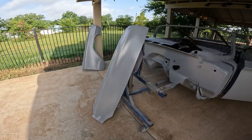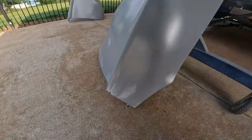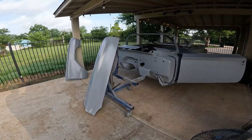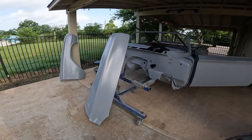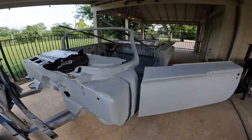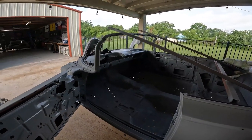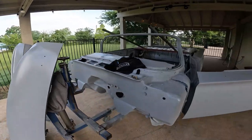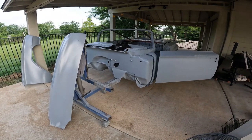You can see this thing's already kind of flash rusted there sitting in the shop. So we're going to get these fenders on, get the filler work done on them, get them back in epoxy, and then they'll be ready for some feather fill. I have a quart left of feather fill - that's going to be enough for these fenders and maybe the dash if needed. It's supposed to be 100 and some degrees today - it's going to be a hot one. Anyways, enough yakking, let me start getting these fenders hung and I'll bring you guys back once we get some sanding.